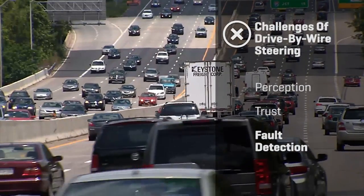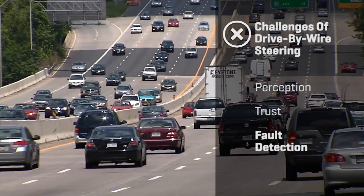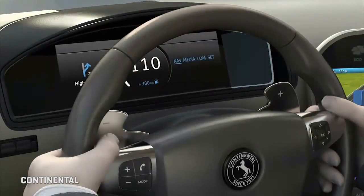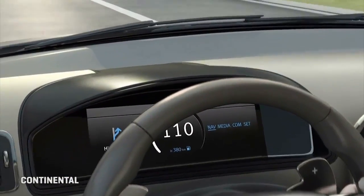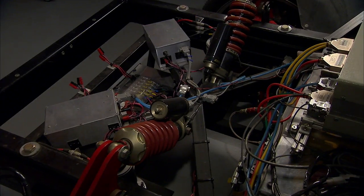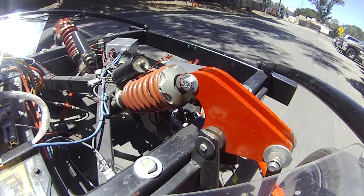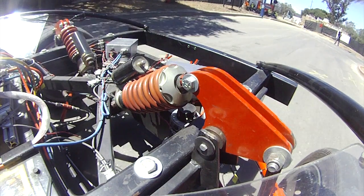And finally, fault detection. Your current car has limited, if any, of this. But in the drive-by-wire world, there has to be a lot of fault-vigilant technology and built-in backups — and all of it done economically. By many estimates, the amount of software it takes to run the basic functions of steering and throttle is only about 10% of what's on there. About 90% is fault detection, fault recovery — the sorts of things you need to handle situations where things are not working perfectly.